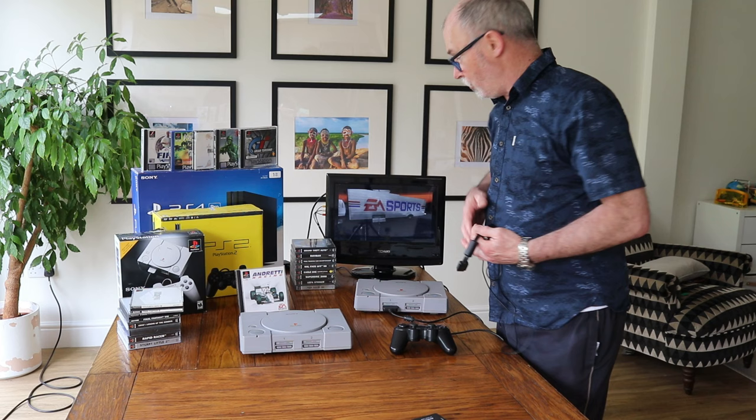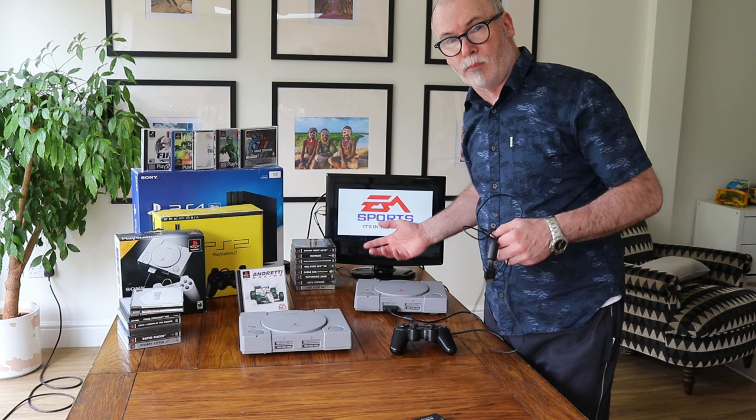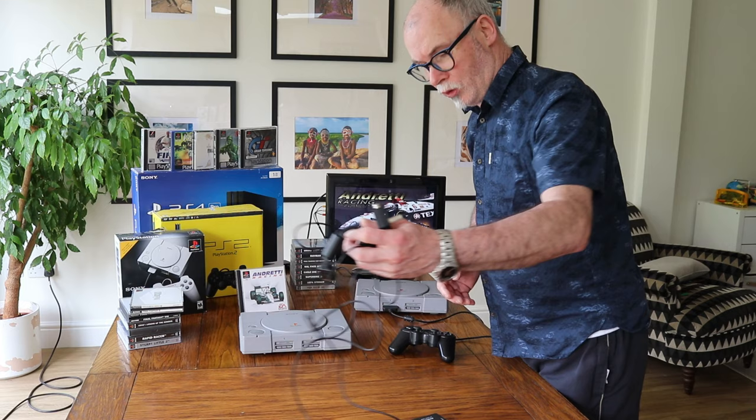Connecting up to the antenna point on the TV is not a good idea. You can in theory do it, but then you have to use the TV to search for the signal — sometimes it picks it up, sometimes it doesn't. When you disconnect your console, most smart TVs will lose what they've saved, which means you may have to retune the TV every time you want to play. That's an absolute no-no.